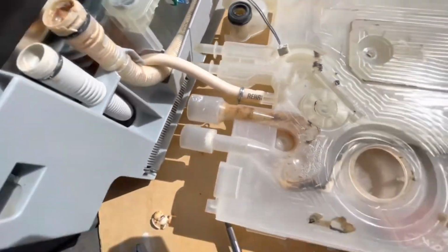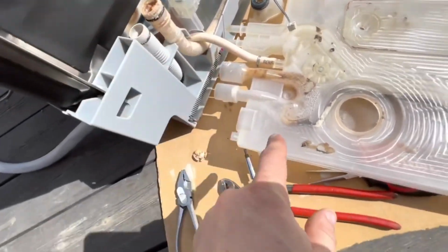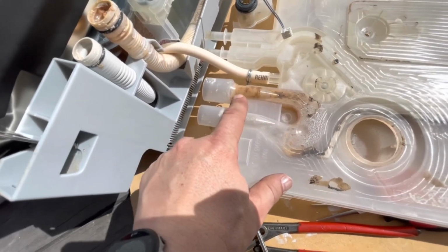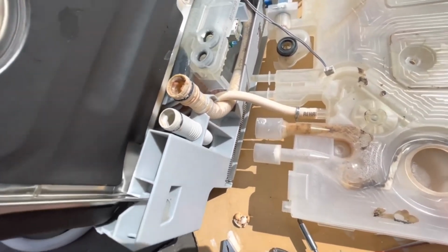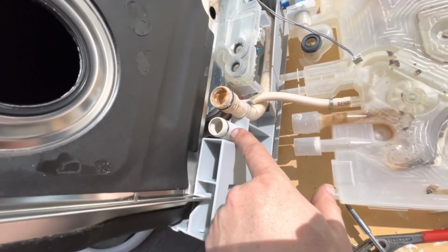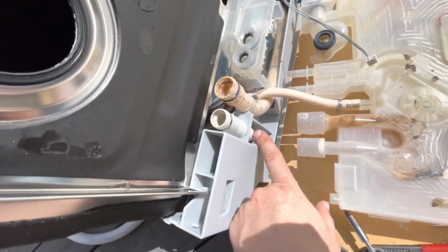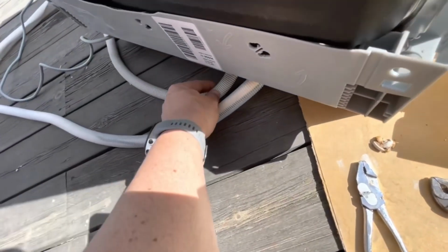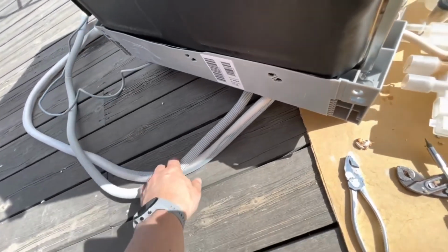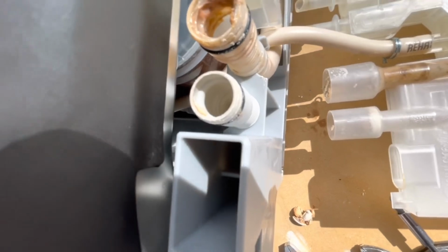But when I pull the whole thing upwards like this, it got loose from these things. There was a whole lot of crap falling out of this pipe. And to explain everything, looking inside there, this is the actual water waste pipe going out of the machine. This little part just goes straight out to this side and out to the siphon. And that pipe actually looks very clean.